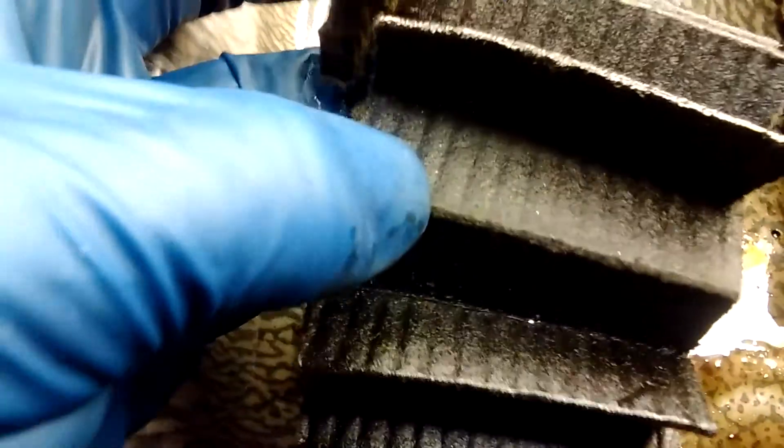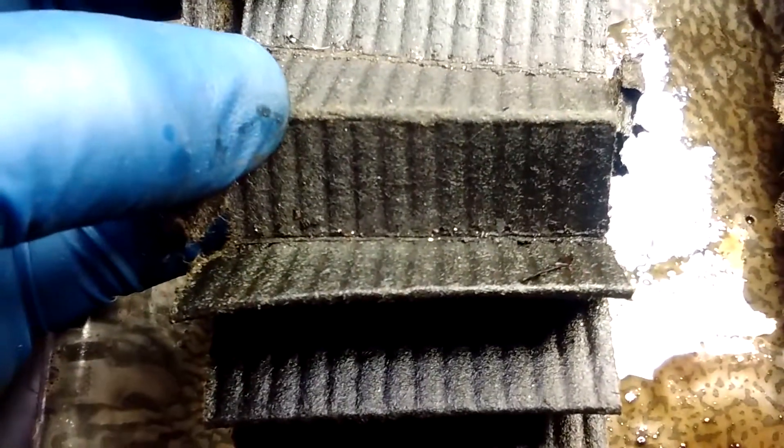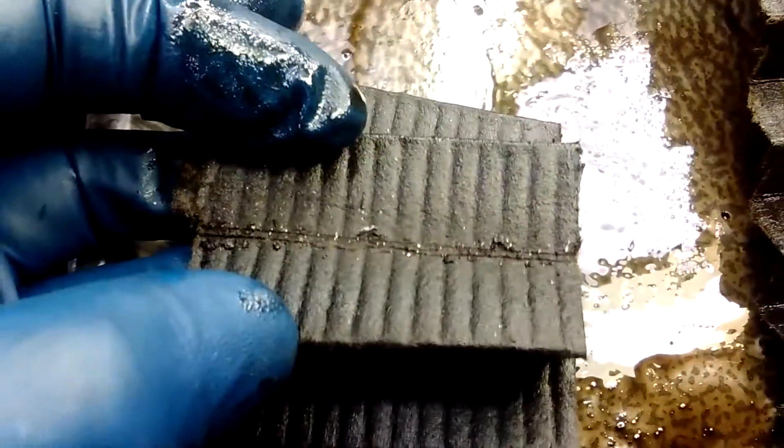Which is not good. There have been several of these thread-like pieces — you can see them right there between my fingers. The darker gray stuff, the kind of dull gray, that is probably bearing material. A lot of trash in this oil filter.